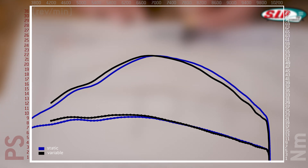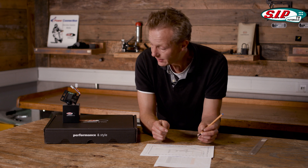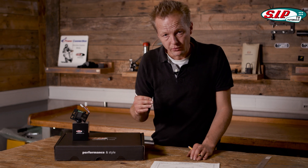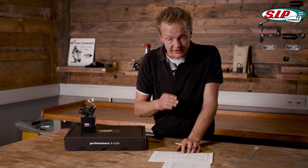In the top range you see that there's almost no difference. This is because both the variable ignition and the static ignition are always adjusted so that at the peak power engine speed there are 15 degrees of advance. The reason is that the ignition is timed to the cylinder manufacturer's proposal of where to time the ignition to.